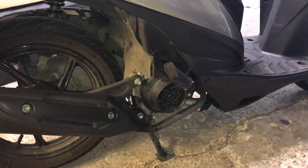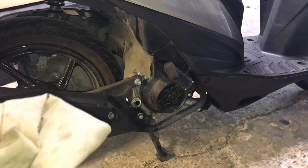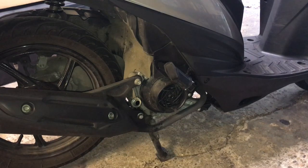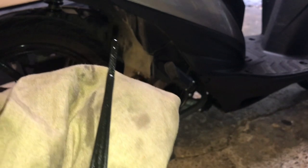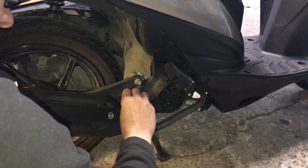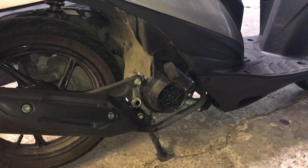Three minutes are up and our egg is ready! I've switched off the bike and now it's time to check the oil. Remove the dipstick, clean the dipstick, and then place the dipstick back into the hole — but don't screw it in, just place it on the threads. Then remove it and have a look at the oil level. That to me looks a little bit low — I'm going to check that again. Yeah, that looks a little bit on the low side, so I'll top that up as necessary and keep an eye on it for the next few days.